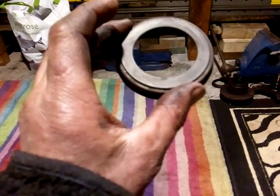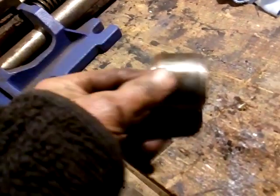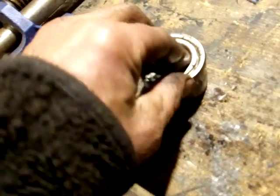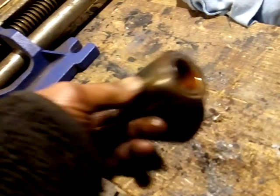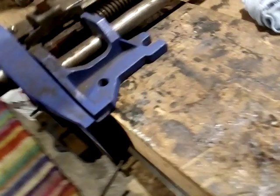All new bearings and we'll be good to roll again. These ABS sensors — this one is supposed to have a slightly serrated edge but it's basically smooth, so I'm surprised it's reading anything at all on that axle. That other bearing wasn't so bad but there was plenty of movement in there. They're both shot — one obviously a lot worse than the other.